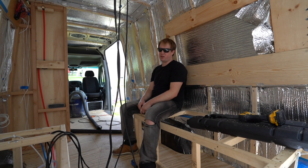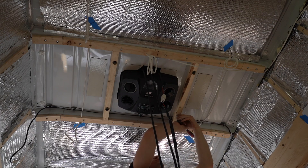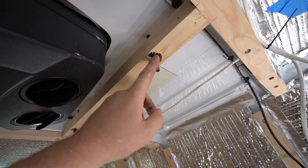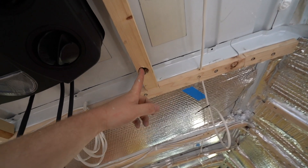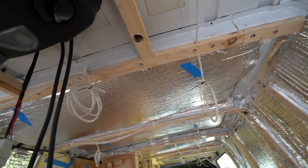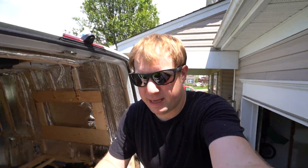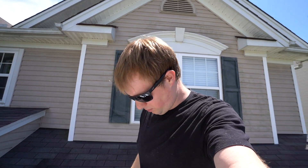It's hot outside. I'm excited for some air conditioning, but that sun coming down is brutal on the roof. You really have to be careful that you don't over-tighten these because it'll crack the housing up top. I just had Heather tighten these for me while I watched and made sure I wasn't flexing too much. This may seem like overkill, but I'm going to put another layer of Sikaflex just to make sure we could drive this thing through a hurricane without leaking.